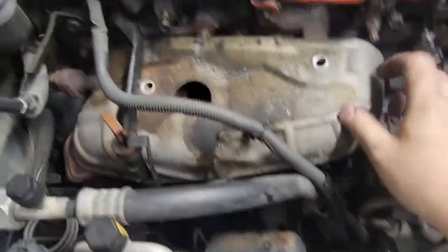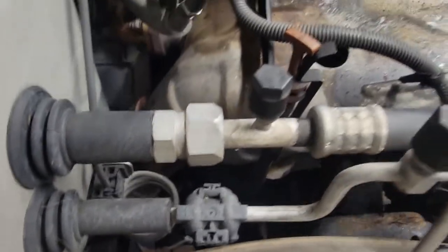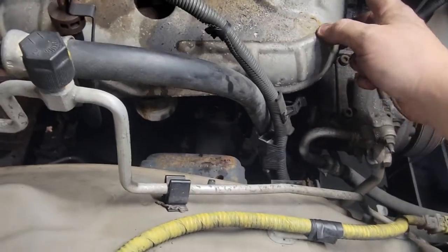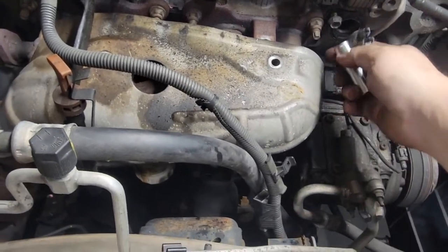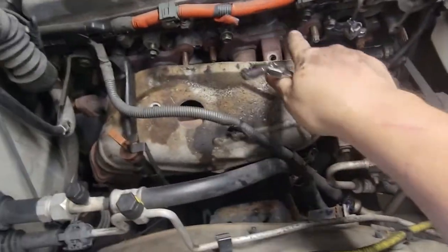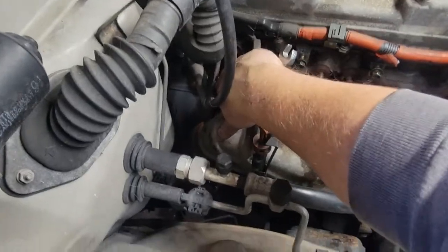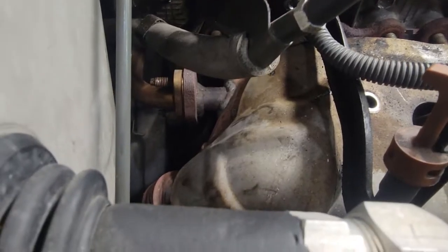With the heat shield, it's two 12s up top, and you have 11s on the side — one and the one back here. The one back here is completely rusted out so it won't come all the way off, but I think I have enough room to slide it back and forth and put my 14mm on it to remove the exhaust. After you get all your 14mm to get your exhaust off up here, don't forget your little EGR bypass down there in the corner — two 12mm to take them off.